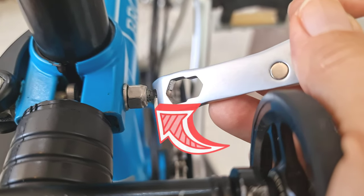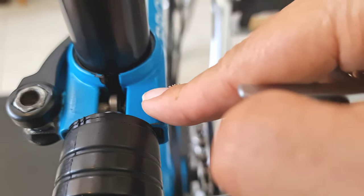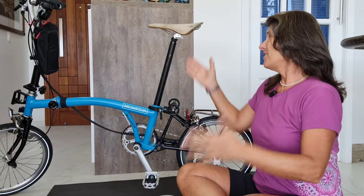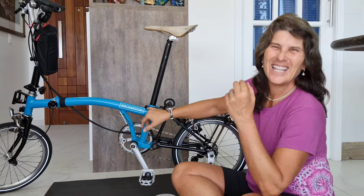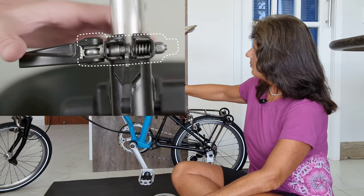This gap here should not be more than three millimeters. If it's four millimeters, it's time for a new seat post clamp. So, if your seat post is sliding down when you're riding your Brompton: first, clean the seat post. If you don't want to take everything apart, at least clean all the visible parts — it does help. It's easy: just take the saddle out and put it in. After you've cleaned it and adjusted the clamp, if it's still sliding down, take it to a Brompton dealer to check whether it's the plastic sleeve or time for a new clamp.